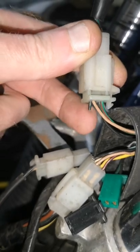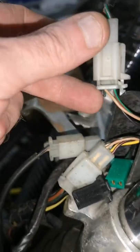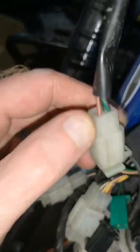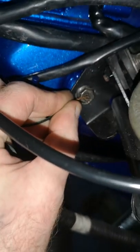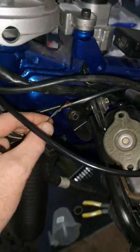That wire there. I don't know if I've said before in any of these other videos what I've made of this bike. But that wire there, the green and black one, there's a plug that goes into your clocks. See the green and black wire? It's cut. That wire there is this wire here. And you see on the connector going to the clocks, there's only three wires there, look. And going in, there's a black wire that goes nowhere here. So you cut this black and green wire, and it's here. And you earth it to the frame somewhere, with a ring connector maybe on there, and this is supposed to be a restrictor. I've never tried it, but that's the wire. But we'll give that a go.